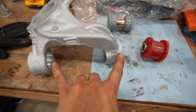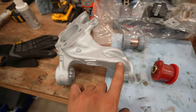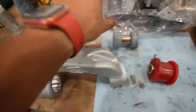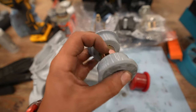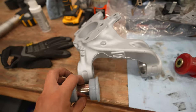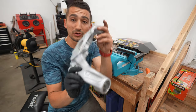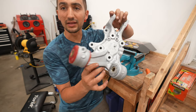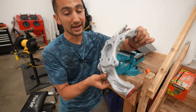From the Energy Suspension master kit, I tried out a bunch of different bushings for both positions — but since they're not the same size, only one works for the rear position of the rear knuckle. For the front position you'll need a different bushing — stay stock or use a custom bushing. This custom one here is a 95 durometer, very stiff polyurethane bushing that uses the same inner sleeve as the Energy Suspension one. Don't forget your glove and lube before throwing both bushings into the knuckle. They're both polyurethane, so both will offer much less deflection than the factory rubber.